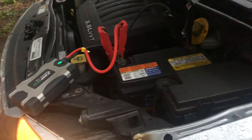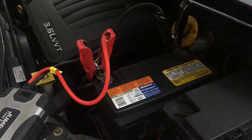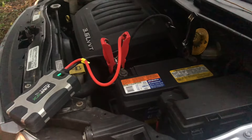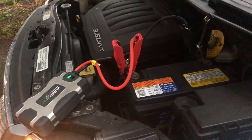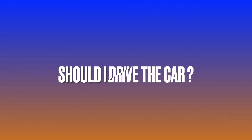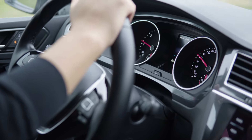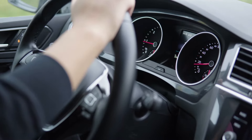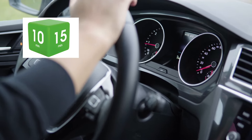So basically, that is what is occurring. Once you start your engine by means of a jump, you should leave your car running. Should you drive the car? You actually should. You should drive your car or leave it running for 10 to 15 minutes.